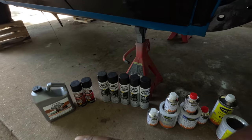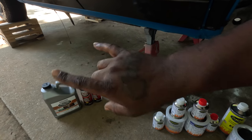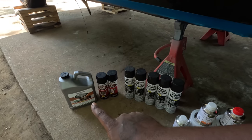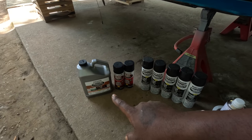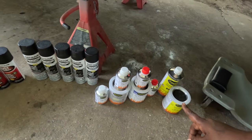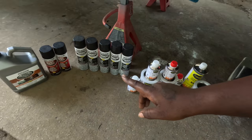YouTube, what's goody? It's your boy Southside Nate, and we back with another episode of the Box Chevy Build. And on this episode, we're gonna pick up where we left off on the last episode and go ahead and get this frame painted. Now, I done a lot of work off camera. I done got the whole entire bottom of the car hit with the wire wheel, sand it down, and then I went through and wiped all the metal down with some of that rust dissolver. Now, I'm about to start painting up under the bottom of the car.